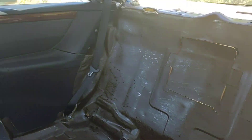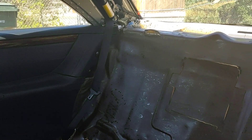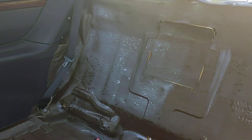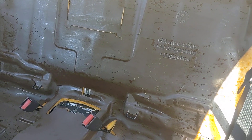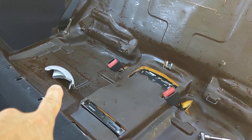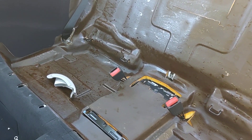In the rear, all we did was put the rear panels from the other vehicle — they were nice in this car, but the other ones were just a tick nicer, so we used the rear quarter trim panels from the donor. The padding was all tattered and shredded on the original piece, so I replaced it. I checked all the components and the wiring underneath — there are probably four or five modules under that trim piece — and made sure there was no shredded wiring, then put it all back together.